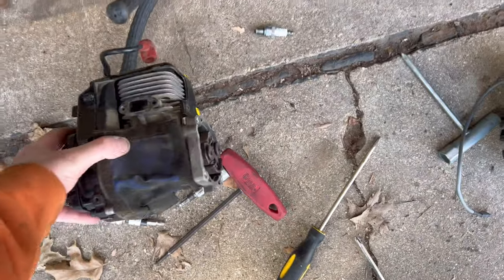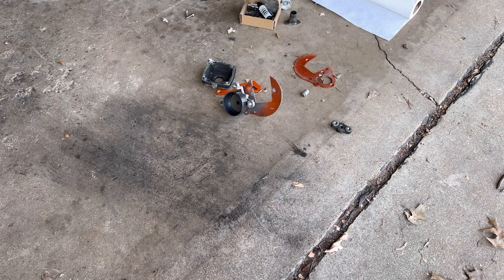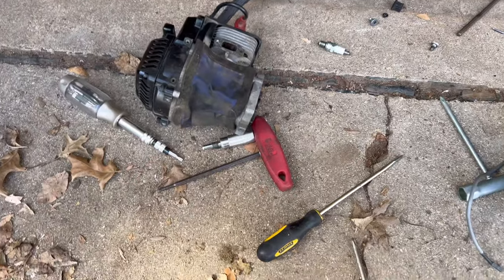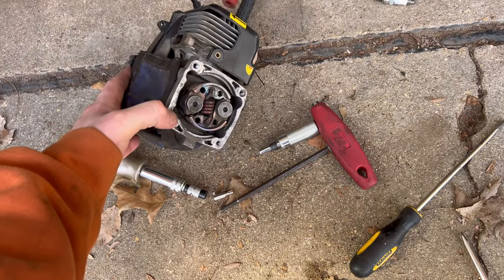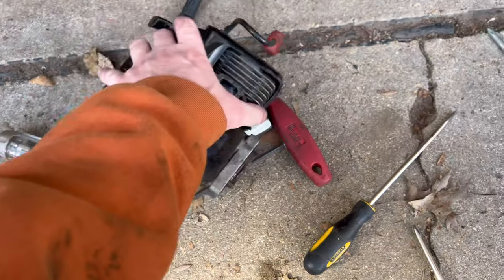The reason I never checked the clutch was because a couple of the screws on the clutch bell were completely stripped out, and I just assumed the symptoms, why it was revving and not getting the power to the wheels, was because the piston rings had gone, but turns out it was probably just the clutch shoe material that had worn down. So this motor's probably perfectly fine.